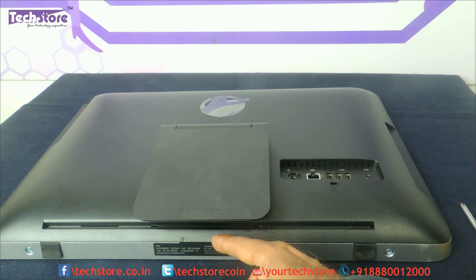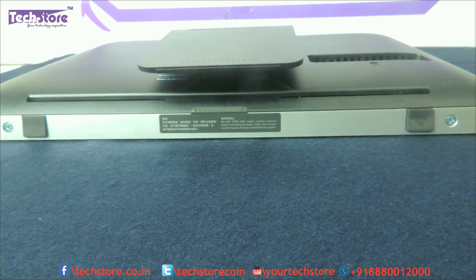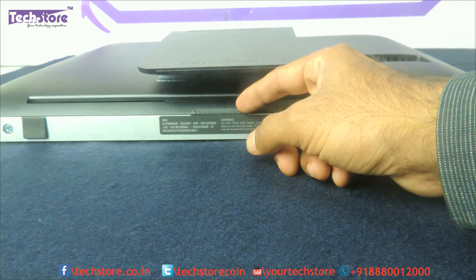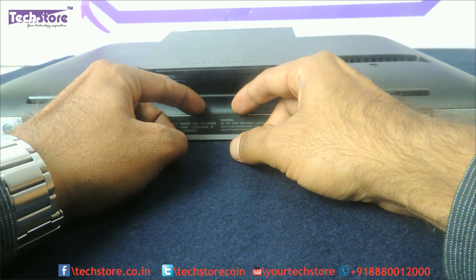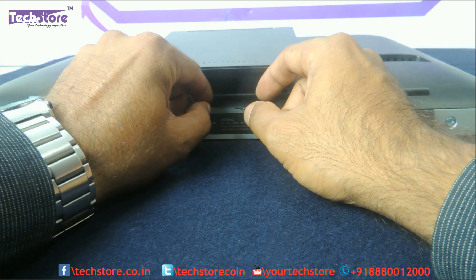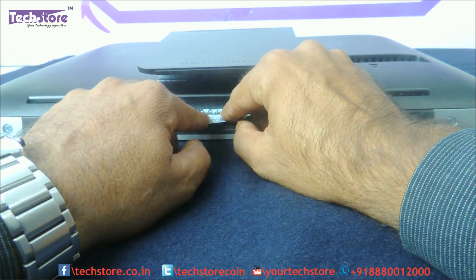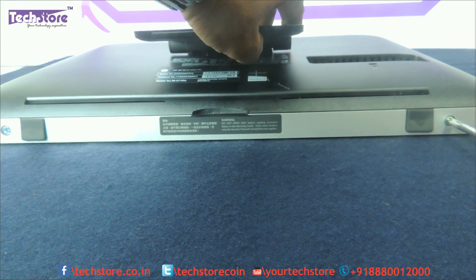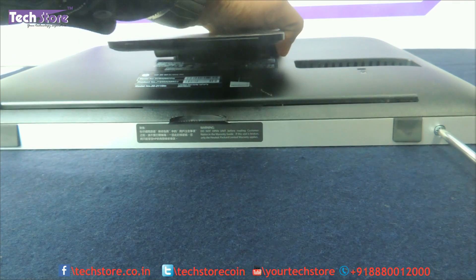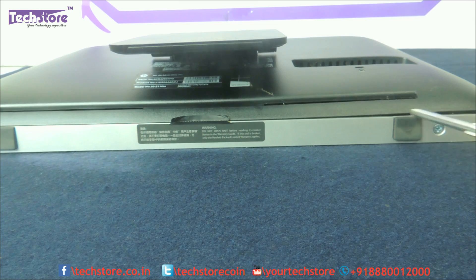Although if you do it carefully, you might actually avoid breaking the seal entirely. These two screws are here and we need to just lift this seal which is covering them so that it does not get broken — just to avoid it getting broken, we make sure it is open beforehand. Next, you just need to take the screwdriver and very gently roll it on the left side. As soon as you do that, you will see the lower bracket panel starting to give away.